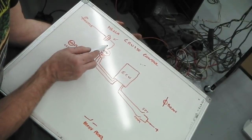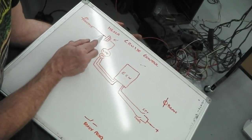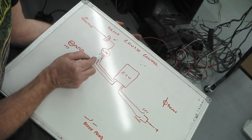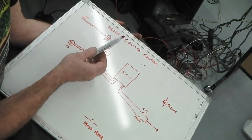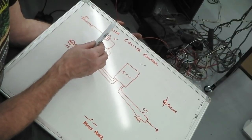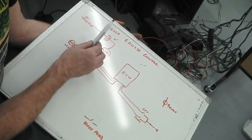It just draws on a vacuum, creates a vacuum in a set of bellows. The bellows collapse, pull on a cable. At certain points, there's a little tiny dump valve that operates, and that creates the bellows to come back out because it lets the air back in. And by cycling those two, you can get the bellows to operate, pulling that cable in and out, depending, and it can be quite fine how it does it.